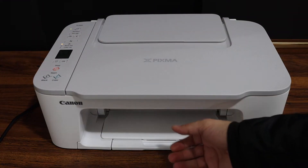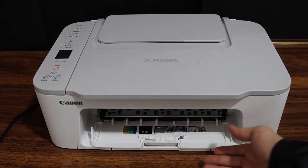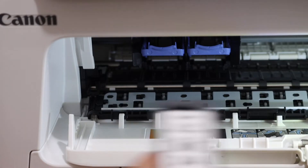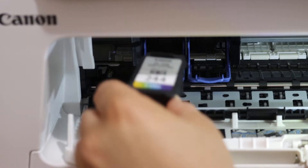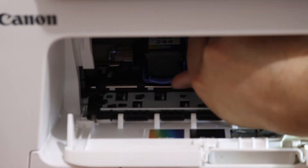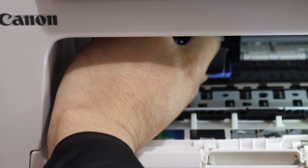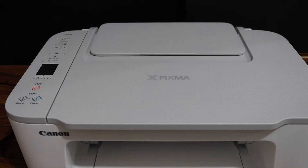To install the setup ink cartridges, we have to open the ink cartridge chamber door. There is a lock here — just push it and it will open. You will see markings for color and black. Place the color cartridge in the color side, slide it in, and push the lock up. Same way, place the black cartridge in, slide it in, and push the lock up. Now close the ink cartridge chamber door.